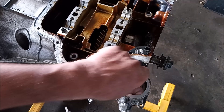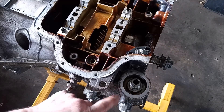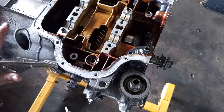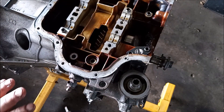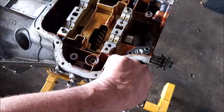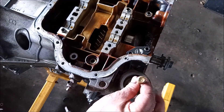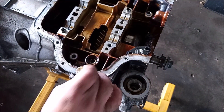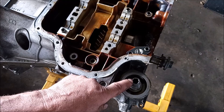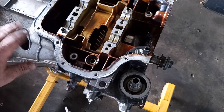Right here in the bottom of the frame, this is the mounting threads for the oil filter — the oil filter would thread on just like this. When you go to remove the upper oil pan from the engine, there is a hidden bolt. The hidden bolt is at the bottom of this oil filter, just down in here. It's a bolt with a 12 millimeter head, and it holds the upper oil pan to the block. If you do not unthread this oil filter mounting thread, you'll never be able to disassemble the engine.